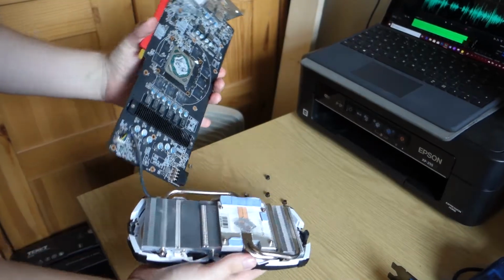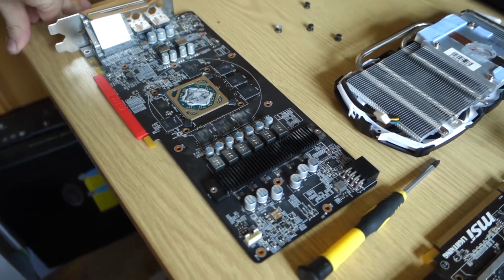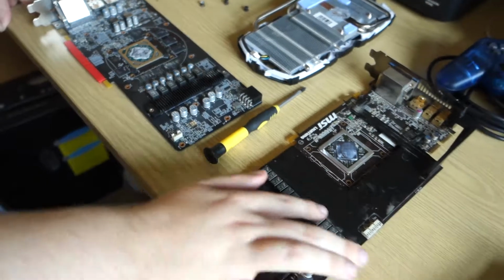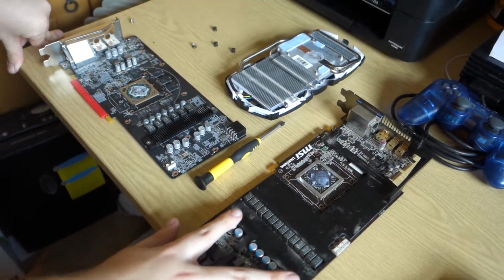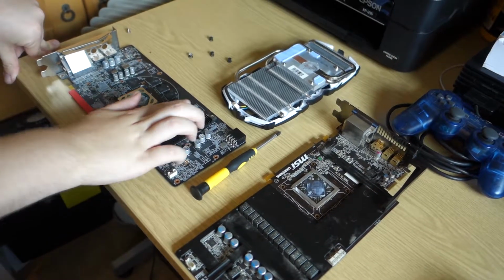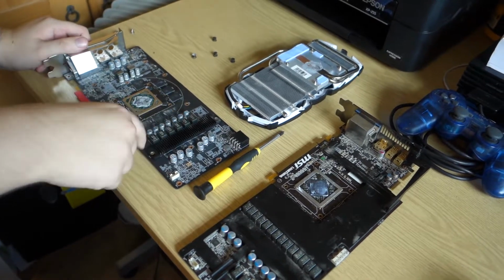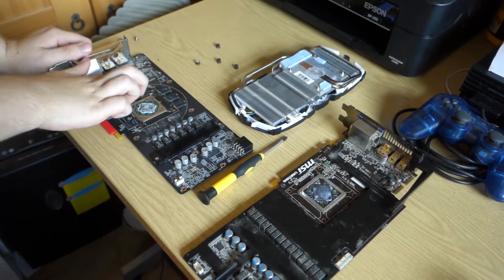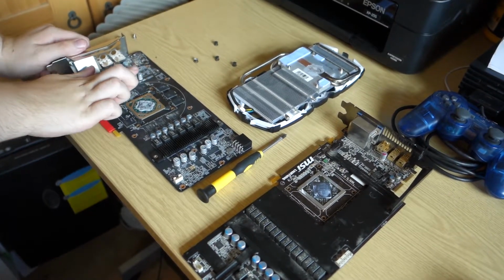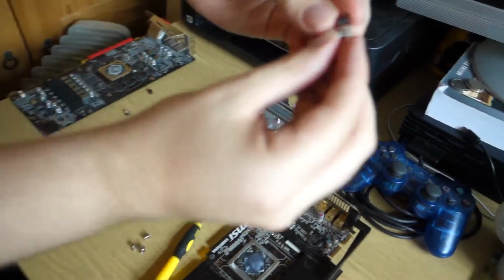There we go. Look how much nicer it is than the other one, because it's got thermal pads and everything as well. Okay. So the issue I'm seeing already is that this has this long line of inductors here, and then the capacitors back here, whereas this has inductors and capacitors right next to each other. Also, this is the VRM. These are the MOSFETs, which have active cooling. That's the first thing I'm seeing. Also, these are high-level surface components on top here. This doesn't have this. First things first, these aren't identical.